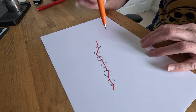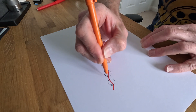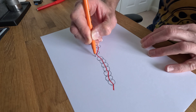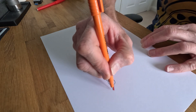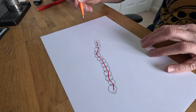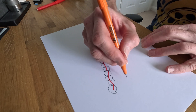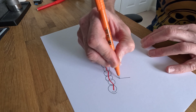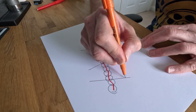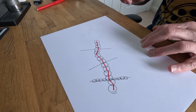From that, he'll tap those, threadlock a machine screw in there, and then chop the head off. He'll then go along and do an overlapping set of screws in that area. What I haven't shown here is that they'll also go to the end of the crack to ensure it doesn't continue. Once that's done, it effectively seals the crack, but it doesn't stop the crack opening up again. So they then need to put a series of stitches across at a number of points, effectively as if you were stitching skin on your body.